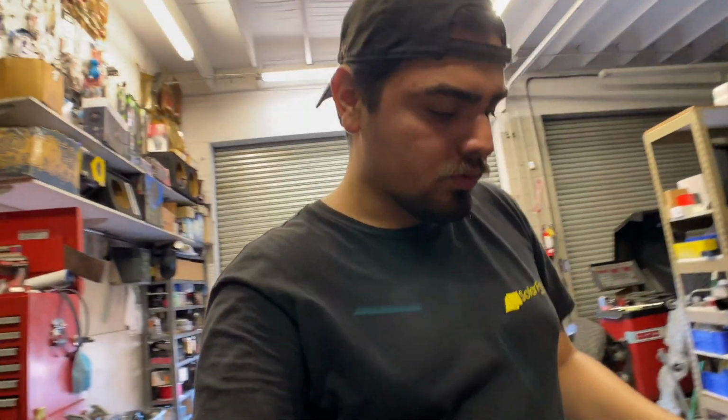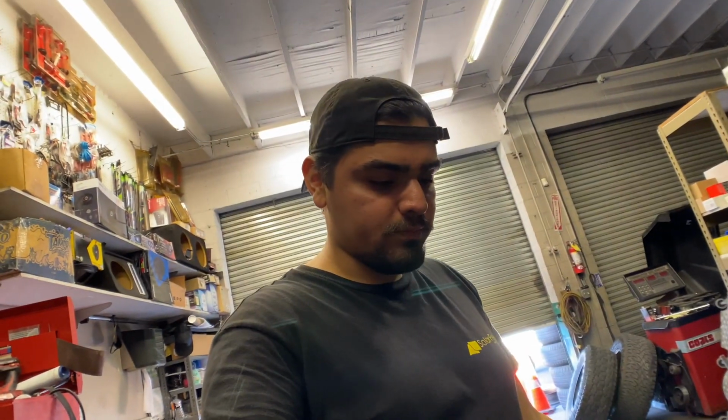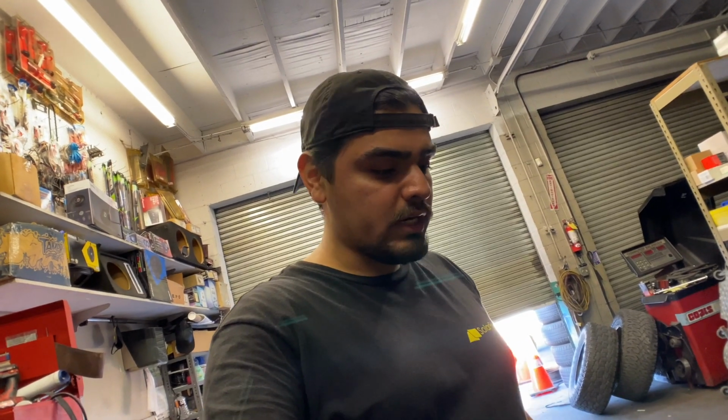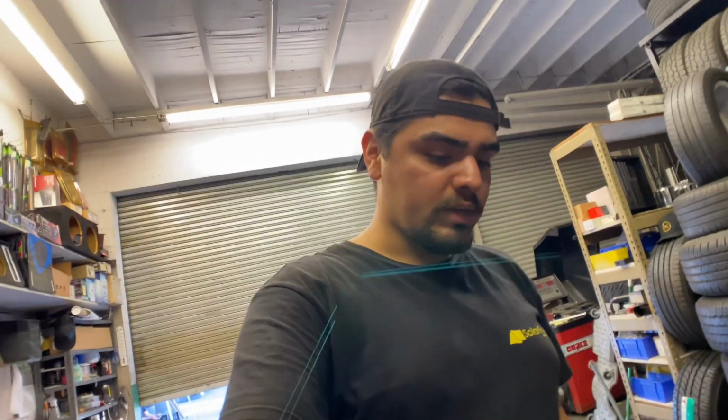So now what we're gonna do, we're gonna start disassembling. So first thing we're gonna do, pretty much pull out the pistons. And to do that, we're just gonna use some compressed air. Hit it, it's gonna push out the pistons, and let me show you guys how it's done.